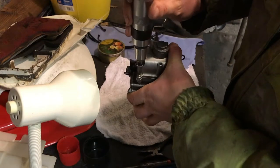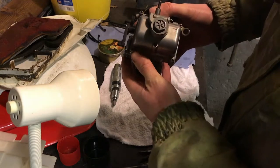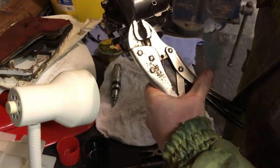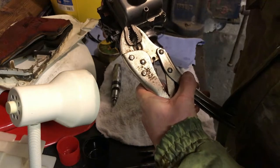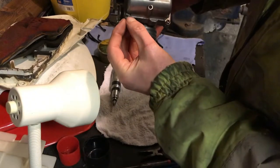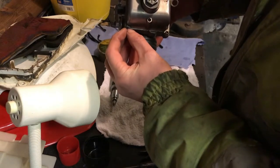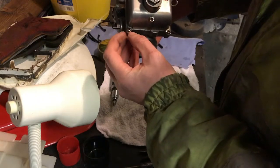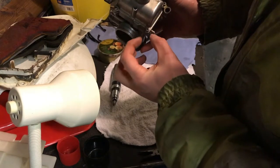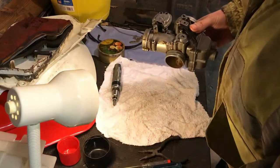You can't go hitting it with a hammer - just hit it with the base of my hand and that sends a shock through it. But failing that, if you can see it's still about to mash up, put mole grips on the edge and just help it along. Also, because these are quite badly damaged, it's best to replace them with new ones when you put it back together. If you really can't, put the worst one on the most accessible area - where you've got the most room to use the grips rather than the screwdriver.